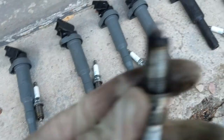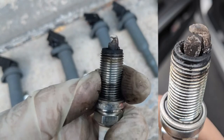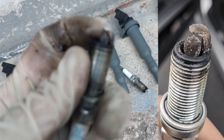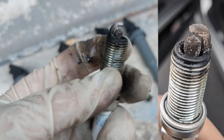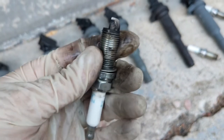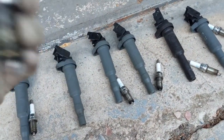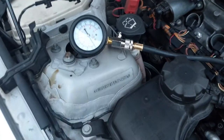This third spark plug was completely caked — black and gunked up, looked terrible. I scraped everything off. You can still see the ridges on the centerpiece and a little bit on the electrode. It's looking more normal now. All the other plugs look good — these are new plugs. I've ordered a new replacement plug for this one. So let's try the compression test again and make sure everything is nice and tight.